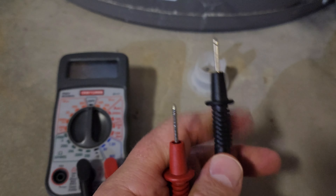There was another option - a comment suggesting to just install a resistor between the leads that normally connect to the vapor sensor. Luckily I had a neighbor with two 10k ohm resistors, so I ran those in series. As you can see right there they're connected, and I'm getting 20k ohms resistance out of those - I tested that with the voltmeter and that's what it read.